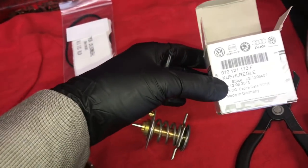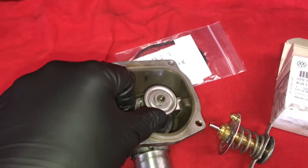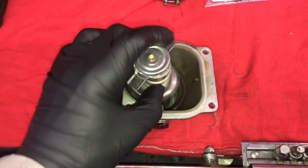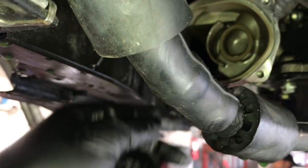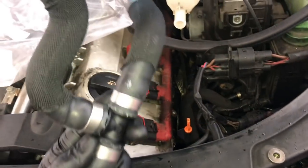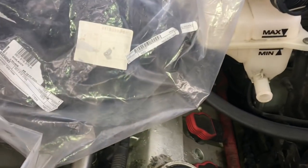Once it's out, remove the hose and pull the clamp off to change the thermostat. You can replace the whole thermostat housing and thermostat, or just get the thermostat and O-ring and reseal it. I chose the latter since the whole housing is a couple hundred dollars — about a quarter of the price just to change the thermostat. It's spring-loaded: press the spring down and turn a quarter turn, and the thermostat pops up. Install the new one, lining up the little port at the bottom, push down, and rotate clockwise. Then put the O-ring into the housing, line up the thermostat housing, start the bolts, and tighten up. Feed the new hose down from the top towards the thermostat, put one end onto the auxiliary water pump and the other end onto the coolant reservoir, then tighten up all the clamps.